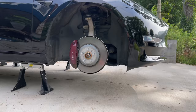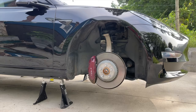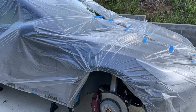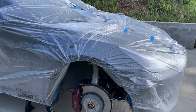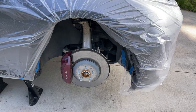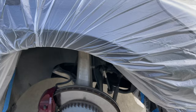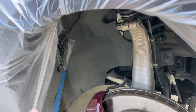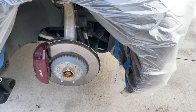Wheels are off the car, off the ground, ready to cover everything in plastic and get prepped. I've got the car itself wrapped in plastic to prevent overspray. I'll wrap everything up there separately, tape it off so you don't get paint on anything. One thing I learned the first time is to do the car with a separate piece and then wrap all that individually — otherwise it just gets kind of messy. The plastic stretches and touches things, so it's better to tape all that off back there and then wrap everything separately.